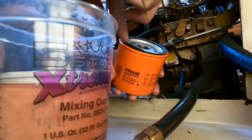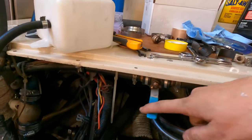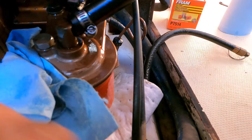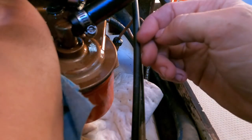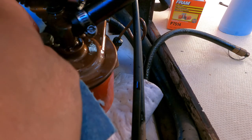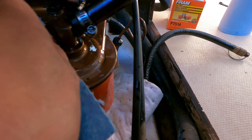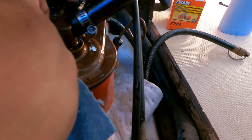Apply diesel to the O-ring. Now you can open your fuel valve. I have an electric fuel pump or lift pump, so I just need to turn the ignition key on, then crack the vent screw which is on top of the filter housing. Eventually fuel will come out because turning the key on turns the electric fuel pump on. If you don't have an electric fuel pump, you'll have a little manual toggle on your lift pump — pump it back and forth to get fuel to come out while you crack the vent screw, and wait until you no longer see air escaping and it's just fuel.